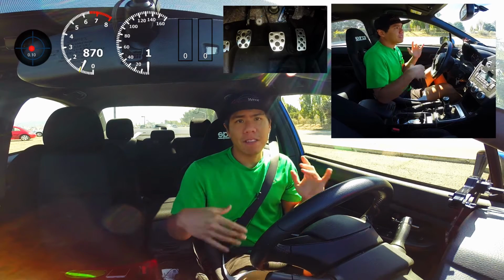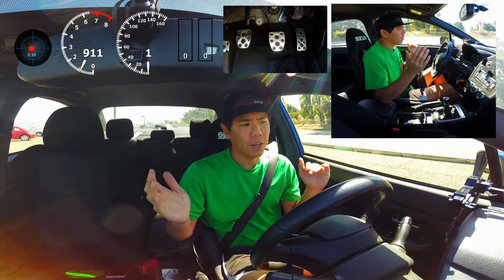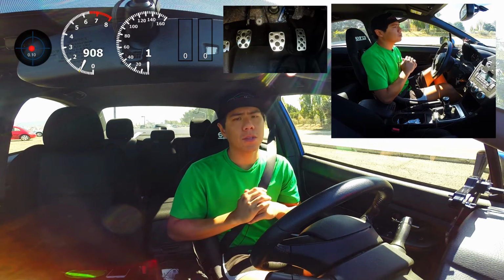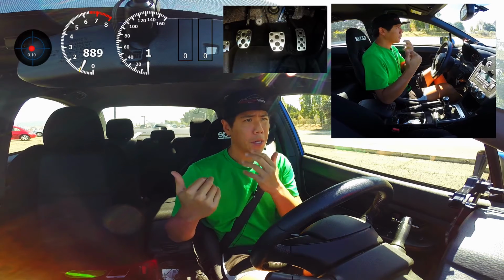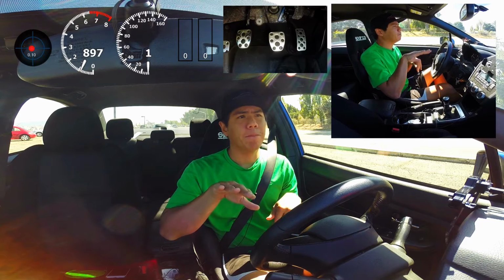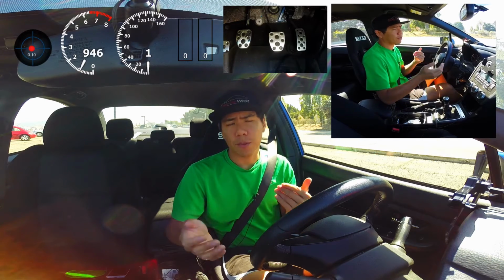Okay, so fundamentally the idea behind the heel toe is you step on the brake, your engine RPM starts to drop as you slow down. You want to shift into a lower gear so that you're in the power band coming out of the corner. Your brake, you kind of start to slide the gear lever out of, say, fourth gear.